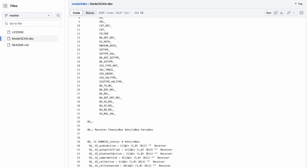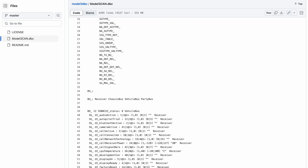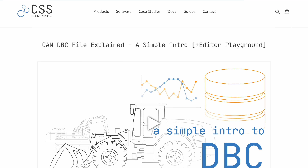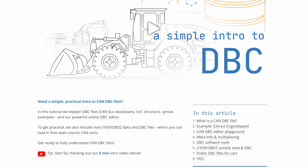A big shout out to the Tesla Owners Online Forum for putting this DBC file together — that takes a lot of work. To illustrate how the CAN messages are processed, here's a brief example using car speed. From the DBC file, I found that the car speed is in a CAN frame with an ID of 599. Inside the frame, the actual speed is located between bit 24 and 32. I copy those bits and ignore everything else. One field tells me to multiply by 1 and add 0, and another tells me the final value should be between 0 and 510 — which makes sense for a car speed. Having that DBC file helped me repeat this process for all the information I needed. If you're not familiar with DBC files, I recommend researching them — they will make your life a lot easier.